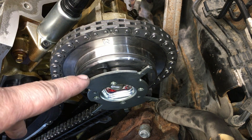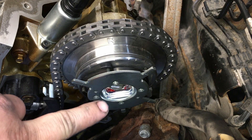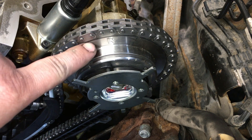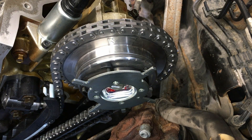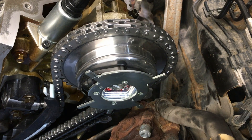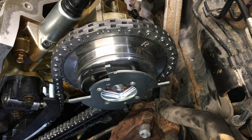The whole engine is timed perfectly right now and both banks are doing the same thing. I'm going to turn the crank manually with a breaker bar, and what you're going to see is the trigger wheel — which is attached to the cam — phase on its own, separate from the phaser sprocket. These should be locked together at base idle, but they keep popping as you go around. Watch — you'll see it happen. There it is, just like that.